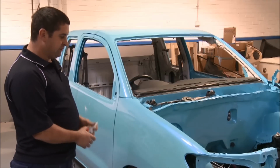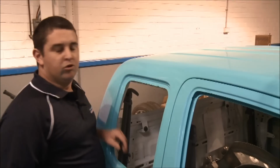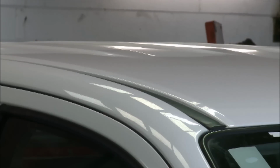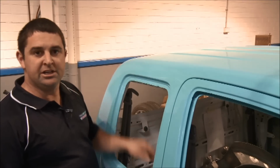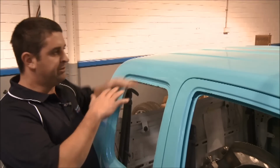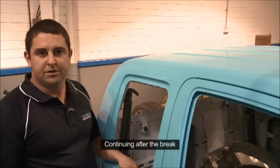And that's the finish that we got straight off the gun. One of the things that they wanted done with this car was to fill in where the roof rail mould goes, which is generally that black strip that runs from the back to the front. And how we've done that is welding a metal plate in from the back to the front. And obviously when you weld that in, it'll warp the roof because it's such a big flat area. So then we've got to tap it up, file it, fill it, and then finish it off.